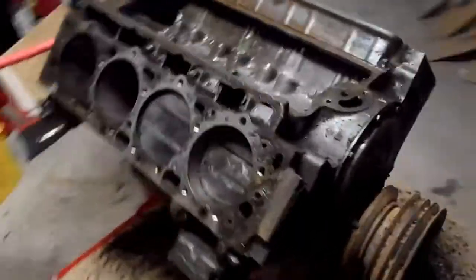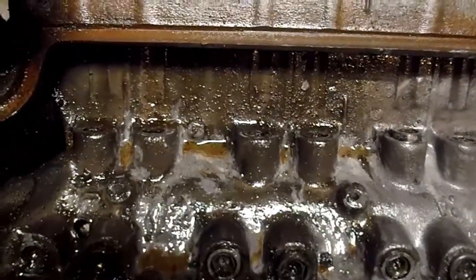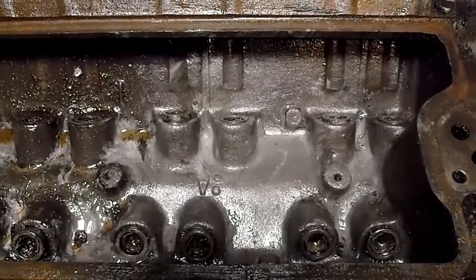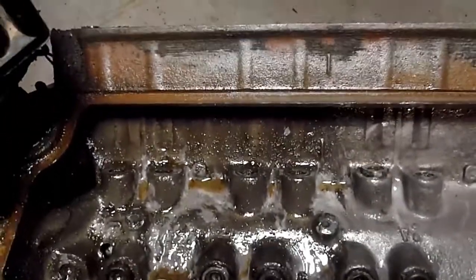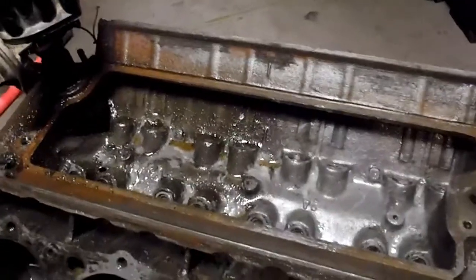I got the heads off. Got most of the top end off. You can kind of see the pistons are pretty beat up from me and my brother breaking it loose here. I just started to clean inside of here, and there was a good layer of caked-on goop almost an inch thick on all of this. I'm obviously going to take this in to get really clean when I take the block in to have some machine work done, but I just wanted to get some of the caked-on gunk off and put a little degreaser in it — it just makes a world of difference. I'm going to keep tearing it down, keep cleaning it up, figure out how to get the distributor off, and hopefully get this thing tipped over and start working on the bottom.